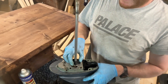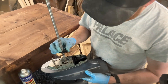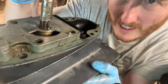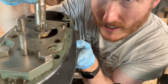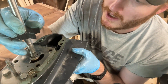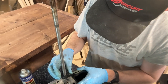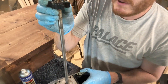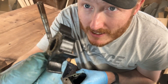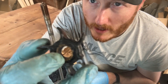There we go — I just felt the pin go then, so that was seated. Can you see it? There's a pin on there — you don't want to lose that. You can just about see it there on the shaft. You should get another one of those with impeller kits, but I'm not going to lose this one just in case. Keep that — be aware of that. Old impeller off — look at the state of it. It will work like that, just about, but it's not ideal. It's more about catching that blade — you don't want it to perish and get sucked into the system and cause a blockage.